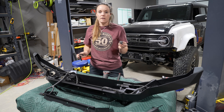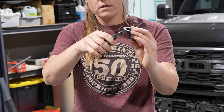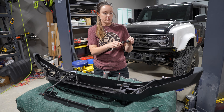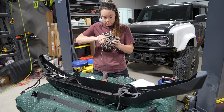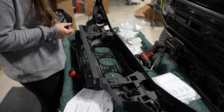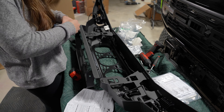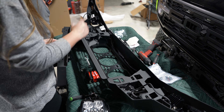On both the front and the rear, you'll need to cut off the little pieces on the side of the sensor — this helps it clip into place since the new bumper is a little thicker than the factory one, so it's much easier to just cut those off. To install your Baja Squadron Pros, start with the metal bracket that goes on the bottom, make sure it's facing the correct direction, and put in the bottom bolt first. To tighten the bolt on the light bracket you'll need a 9/16th wrench. To install the Baja Designs LP4s it's very similar — start with the metal bracket with the bottom bolt, then move to the side. After you get your LP4s assembled, attach all three lights to the bottom bracket and reinstall it into the bumper.